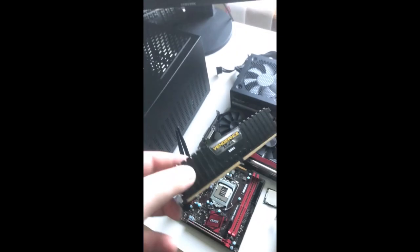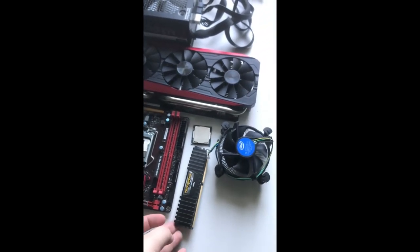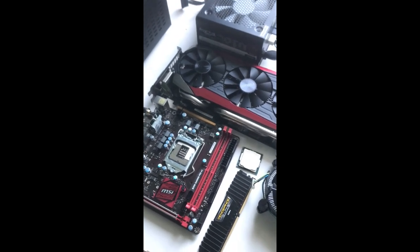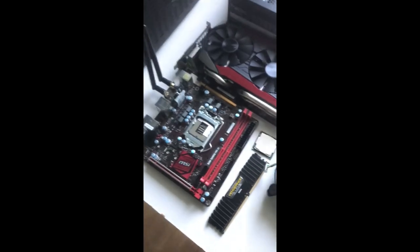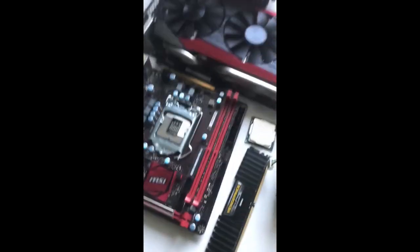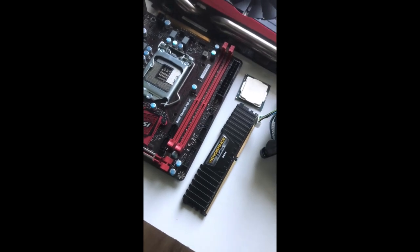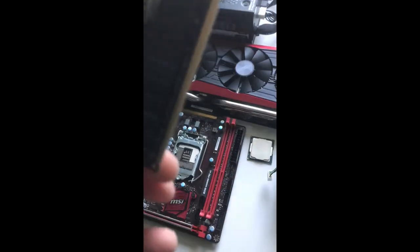Then we've got a single 8GB stick of DDR4-2400 — it's a Corsair Vengeance LPX stick. Snekit wasn't sure this actually worked because he had some blue-screening issues that seemed to be fixed by switching to other RAM. But I ran MemTest for a few hours and didn't get any errors. I also updated the BIOS and ran Prime95 and could not replicate the blue-screening issues, so as far as I'm aware this is just a fully functioning stick of DDR4, which is quite nice.